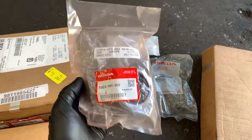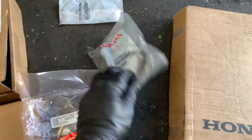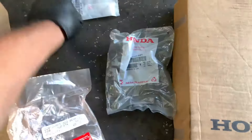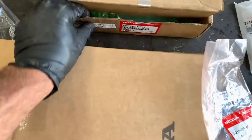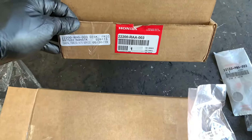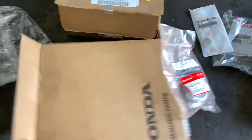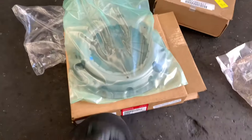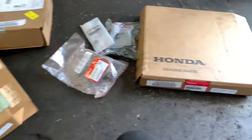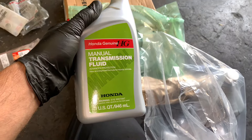In this video I'm going to be using all Honda factory replacement parts, linked in the description. We're going to replace the rear main seal, the pilot bushing, throwout bearing, pressure plate, clutch disc, and also the flywheel. The only thing we're not going to do is replace the slave cylinder and master cylinder — the hydraulic side was working in perfect condition. I'm also going to be servicing the transmission fluid.